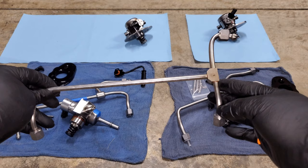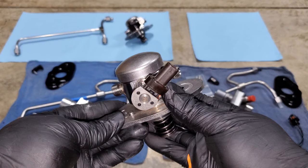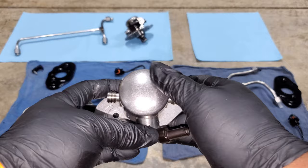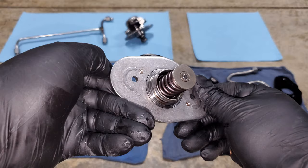You can see the high pressure fuel line — this is the high pressure rail for the stock fuel pump, nothing too crazy there. This next fuel pump is designed for the second generation B58, also known as the TU pump. You know it's the right pump because it has this round dome on the top with no dimple, and the sides look a little bit different. This is what the flange looks like on the correct fuel pump, so if you're looking for one on eBay it should basically look like this.